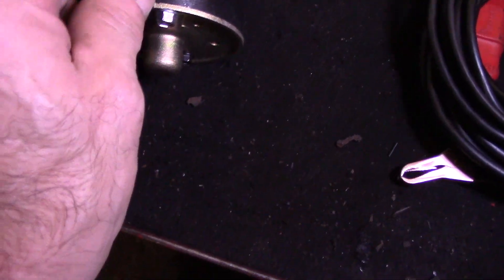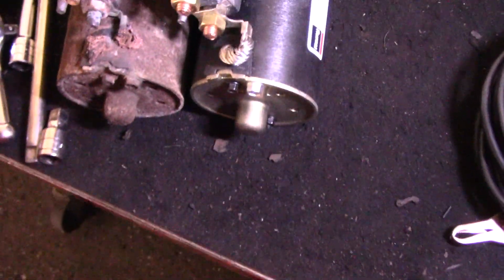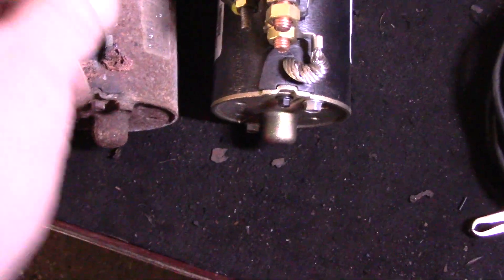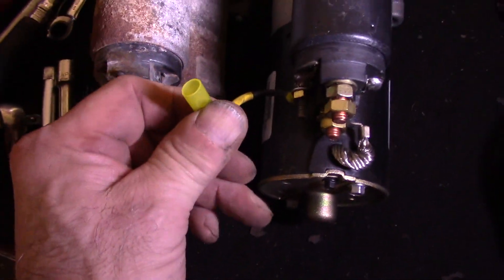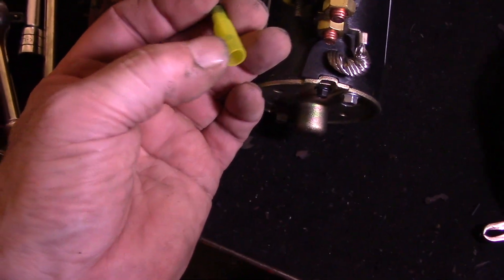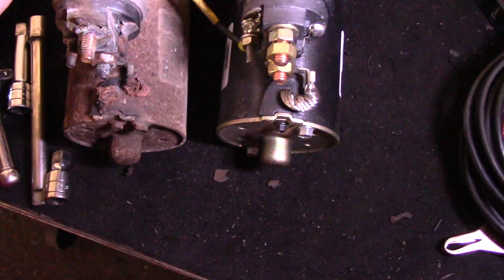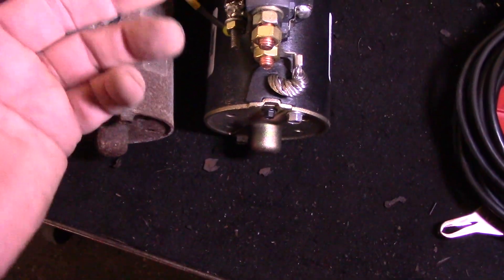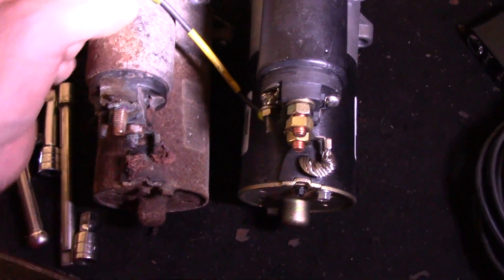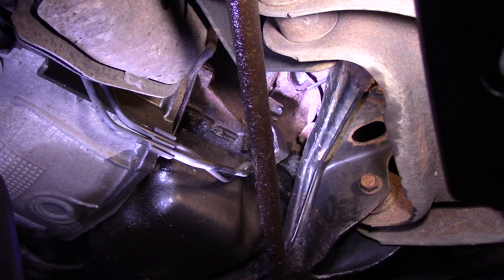Okay, just got the starter motor. I just want to show this to you — see how this is broken? Look at how thick that is — it is very common, that happens a lot. It didn't matter if that other wire broke off anyway, because we have to cut it and splice it together or use heat shrink tubing on it so we don't have any issues with the start wire. They must have anticipated this problem because they supply a new start wire. We're going to snip the old one and crimp it in here, then heat shrink the tubing.